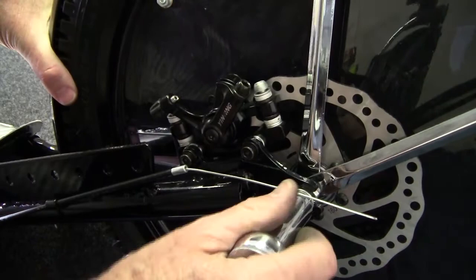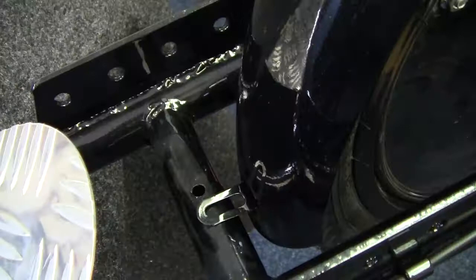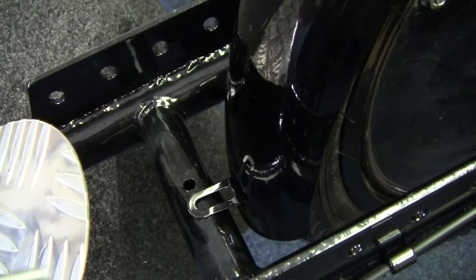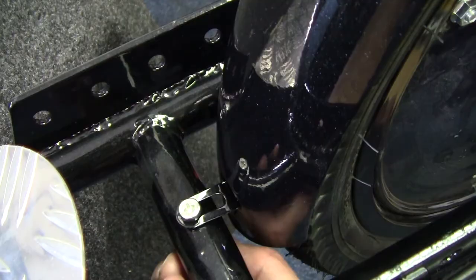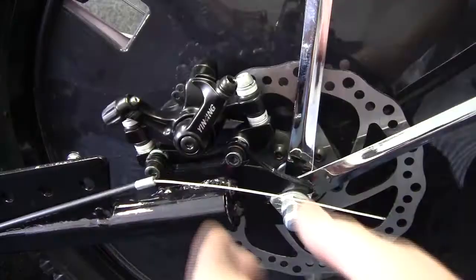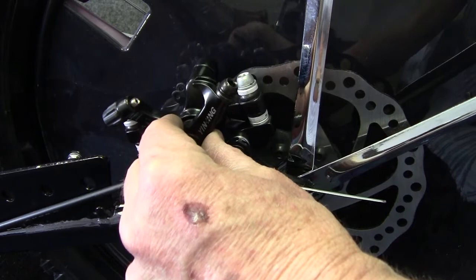The little tab on the front of the fender is bolted to the crossbar using the 6mm by 30mm bolt — that's the smaller diameter with the longest length. It goes through the tab, through the cross piece, and a zip nut on the bottom. Tighten it with a wrench or a socket. Next, center the caliper over the rotor so that it's not touching on either side, and tighten down the two top screws.